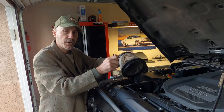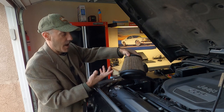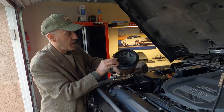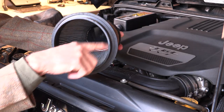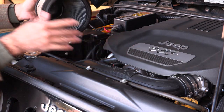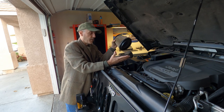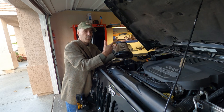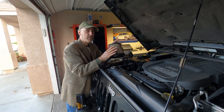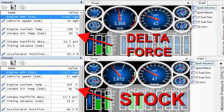You can see this is a healthily used, two-year-old dry air element with lots of miles and many trips. I would knock the big chunks off, maybe hit it with a car wash brush, then hit it with the air hose. Assuming two years is enough — it doesn't ever really look super clean — but the inside is pristine, and that's the point: that dirt is not getting inside the engine.